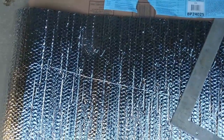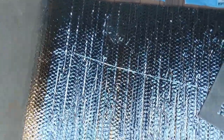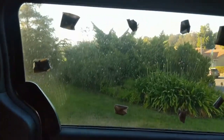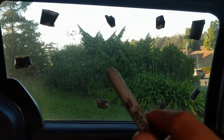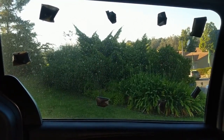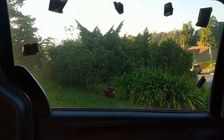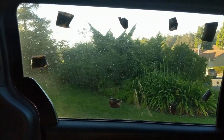What you're doing is you measure your window — I'm going to be doing the sliding window — and you just make it the width of the widest dimension. Inside the van, you can see what I've done is I've put some duct tape against the window. Now if you have tinting on the inside that is done by an owner and is plastic, that might affect your tinting. But if it's from the factory, it isn't plastic on the inside, it's glass, so the duct tape is fine. It'll also come off fine on the Reflectix as well. We're just going to push this into place and stick it, and then we'll be able to trace around the sides.